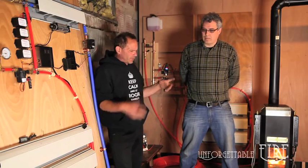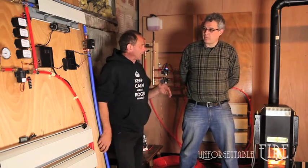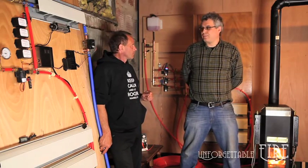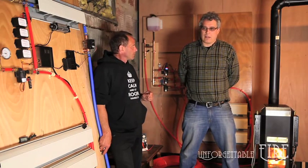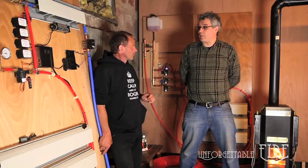When you've got one of those trickle chargers for a car that you plug into the wall, they vary anywhere from 500 milliamps to 2 amps, with some going up as high as 6 amps. Trickle charging at even an amp an hour would allow for a lot of excess power for LED lighting, for example, on a battery system.